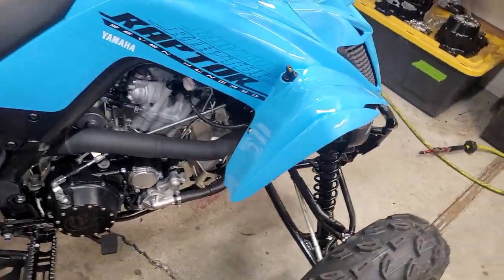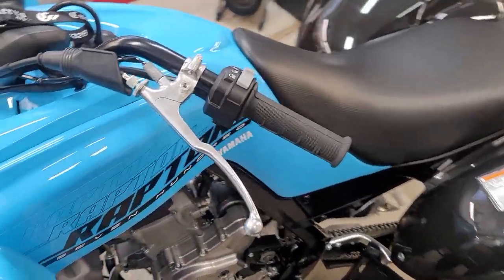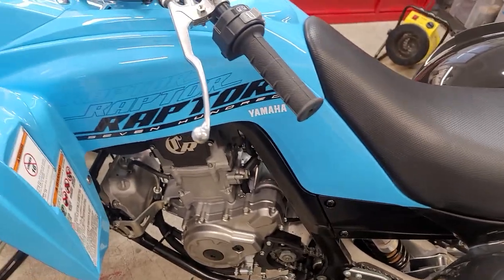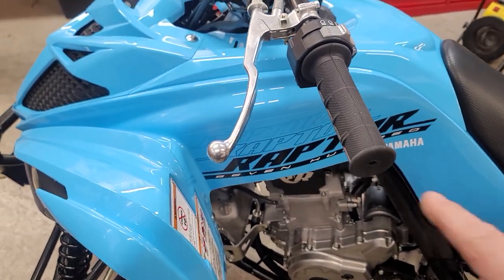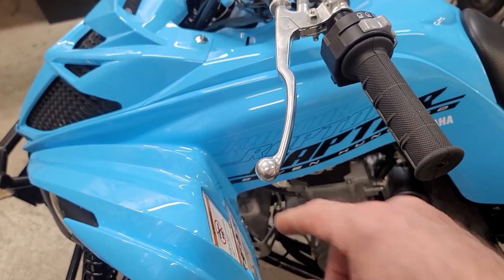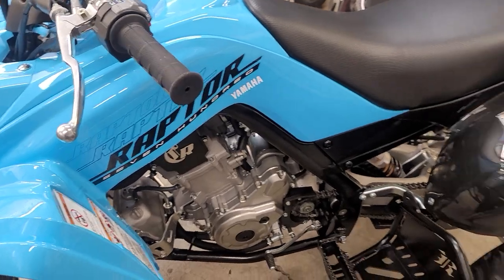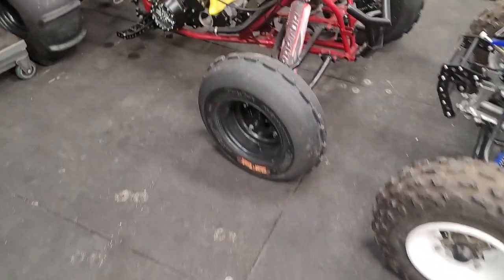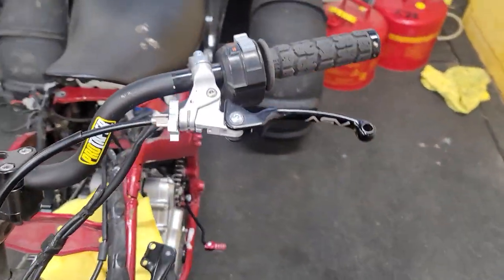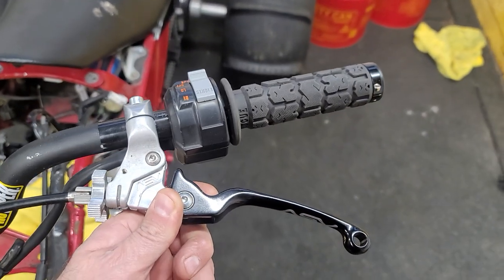So this lever assembly is the closest to a factory setup - very close, just a touch off. But the biggest concern with most riders is the factory lever has a terrible out-sweep design on it, which makes that lever extremely far from the bar. That's why a lot of guys are buying the ASV levers - so they can run them a lot closer to the bar. They all have adjustment in here, but any bit of adjustment pushes them out really far really quick.